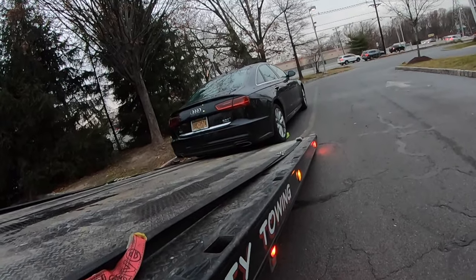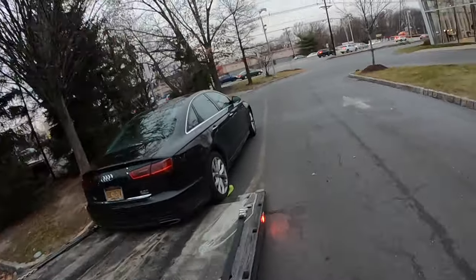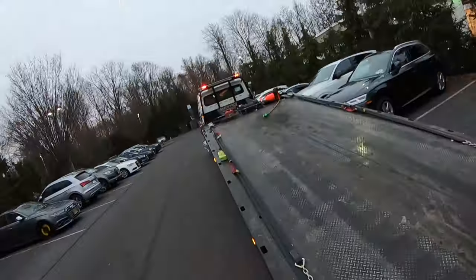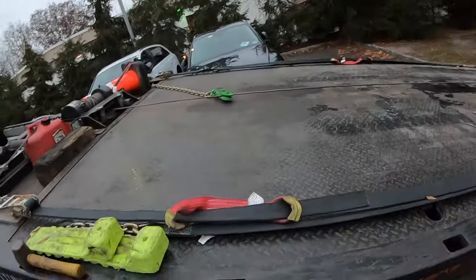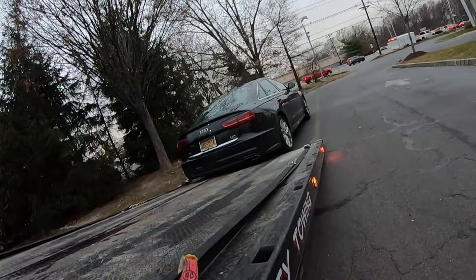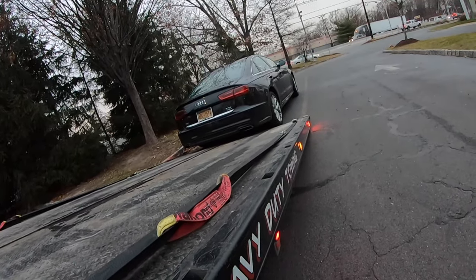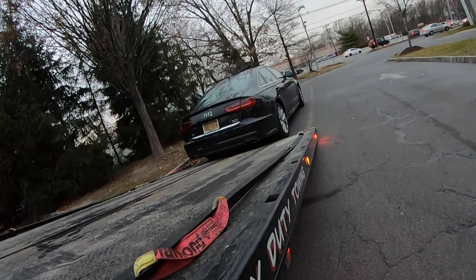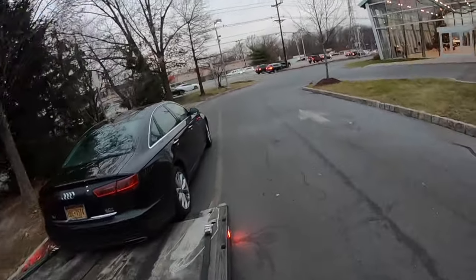So now, we'll have to get that one out. Okay, there you go, you heard it. Now just tilt up on the tire a little bit. Take your skate right out, and you are done. There we go. Finally, the best thing you can invest in is skates and a snatch bar. So, we'll extend it out a little bit more. And now the car is officially on the ground. Pull your bed in. Loosen up the cable as you're doing it. And that's it. Put it in park.